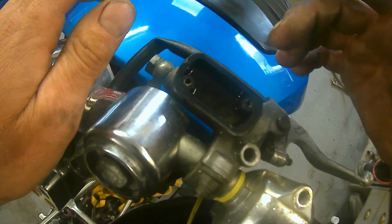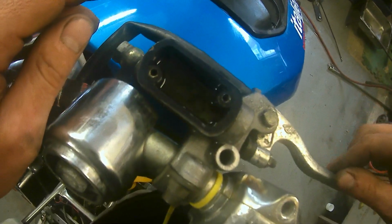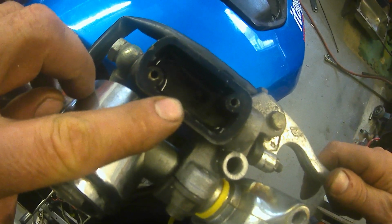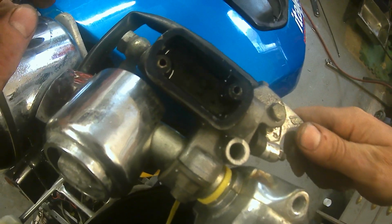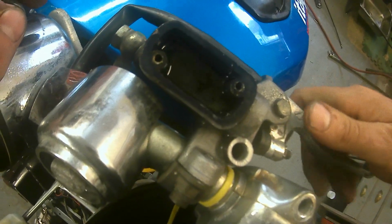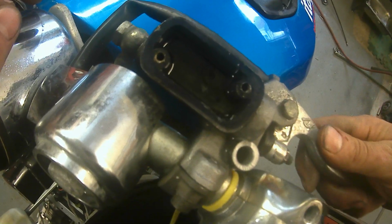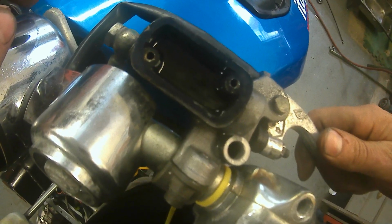It can be an absolute pig if you leave the brake lines off and let the whole system go dry. So my method is fast, fast, fast, fast, fast, and then just see that little bubble of air come straight up through the middle. It takes forever, but trust me, it works. If you've got the patience, there's a good bit of air comes out, and eventually you will get a pedal or a lever.